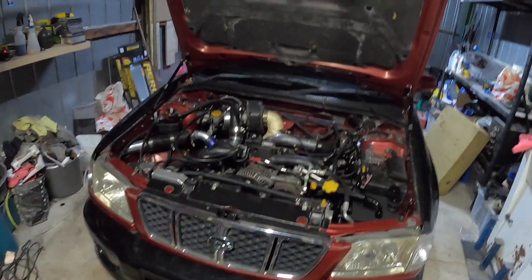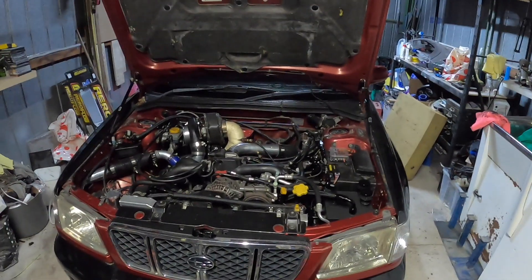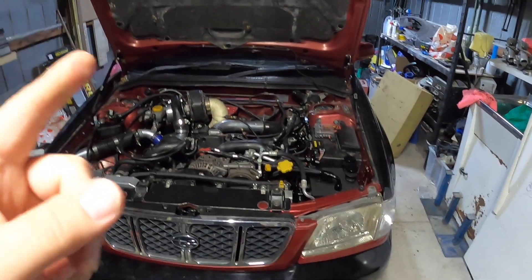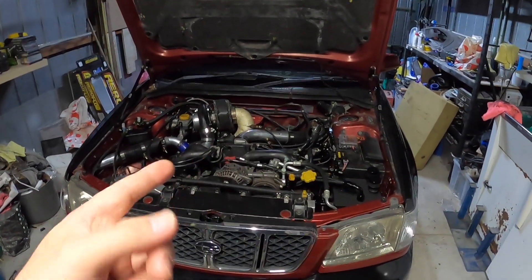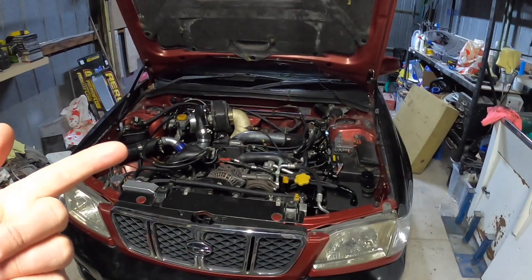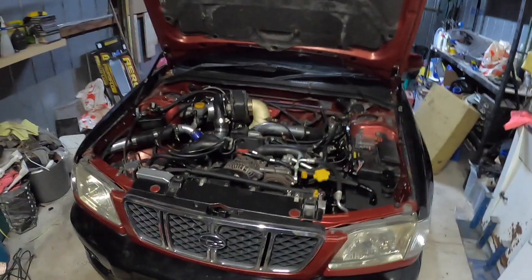I've been playing around on the computer looking at the log. My vehicle speed sensor was way out - it said I got up to about 120 where I clearly didn't. I was putting around probably 40 k's, maybe maximum 50. So I just downloaded a GPS speedo on my phone - I'll have that in the car. When I see it at 20 kilometers on the laptop, which is where I've got it set to calibrate, I'll sync them at different speeds. I've got to make sure that's right because vehicle speed is in some of my tables.